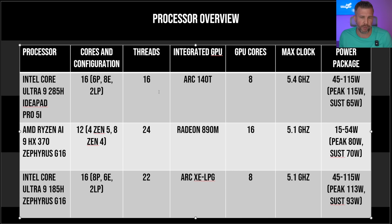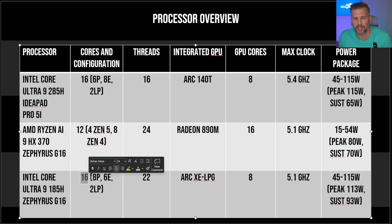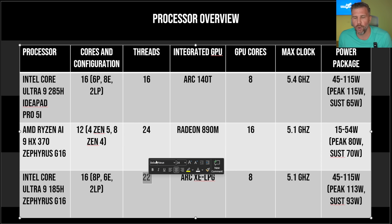The specs are also quite different. The new Intel Core Ultra 9 285H drops hyper-threading — 16 cores, 16 threads on the 285H versus 16 cores, 22 threads on the 185H, which had hyper-threading on the six performance cores. That does affect multi-core rendering performance. The Ryzen AI9, on the other hand, has four Zen 5 cores and eight Zen 4 efficiency-style cores, and a total of 12 cores and 24 threads, which provides a lot of multi-core rendering performance.